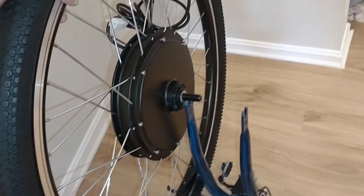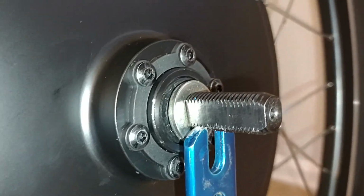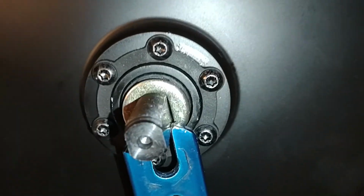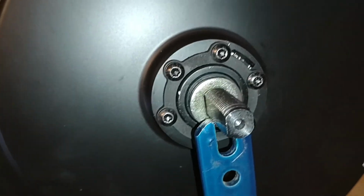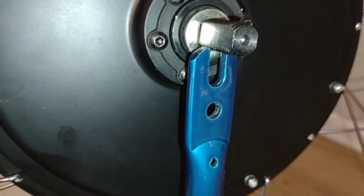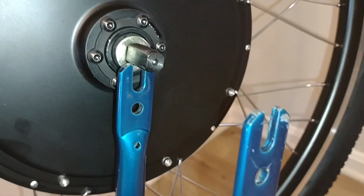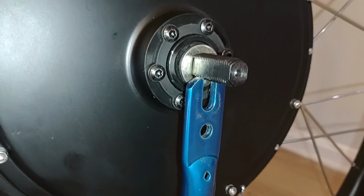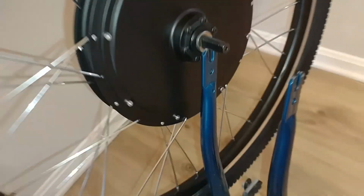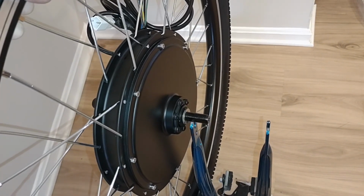Okay, so see, I pulled the tire off, and I just wanted to test fit it against this fork right here, and it is definitely too wide to fit down there. It will not fit down. It's close, but it's too wide. And so I think maybe I could either grind it, which is a little bit more risky, or maybe I'll file it and make these forks a little bit wider so that the bike will accept this tire. I think that's the next step here.